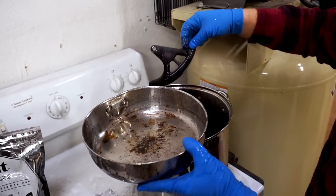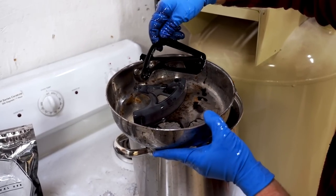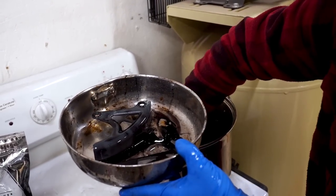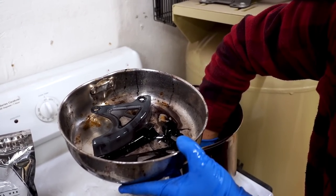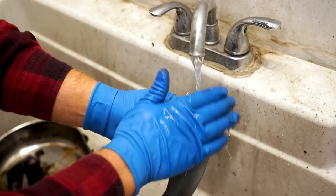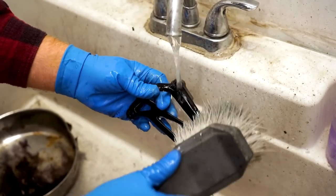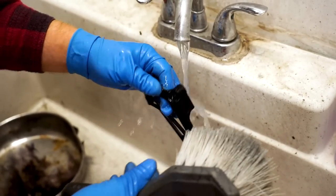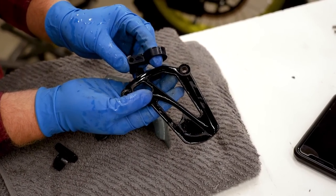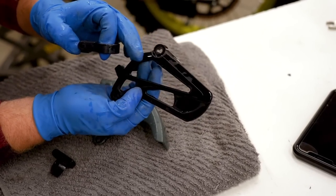Let's take a peek at these plastic parts and see how they dyed out. This is the rotor guard — oh, that's not looking too good; didn't really take the dye. The sprocket cover — yeah, that's black, that looks really good. That looks pretty good as well. It's interesting how different types of plastics will accept that dye and others won't. All these parts look pretty solid besides the rotor guard. So let's rinse the parts off. Yeah, that rotor guard does not look very good. Sometimes the black can look kind of purplish in the sun, but this one actually looks jet black. Some of these parts will turn out kind of purplish and others black. This brake line guide is a bit purple for my liking, but the sprocket cover turned out just perfect. So it really boils down to the type of plastic — it's kind of hit and miss.